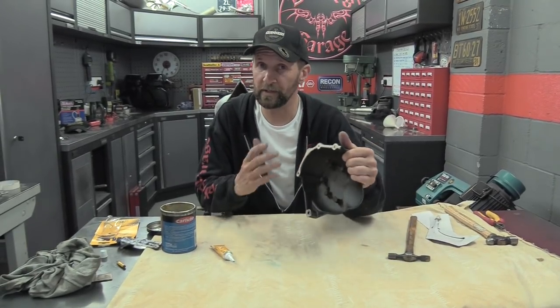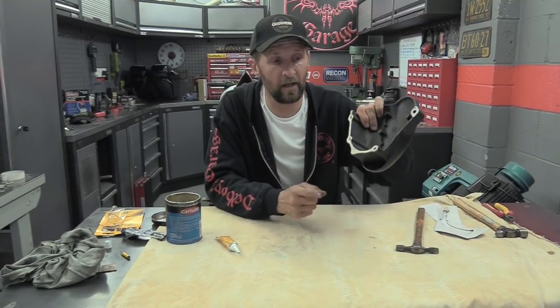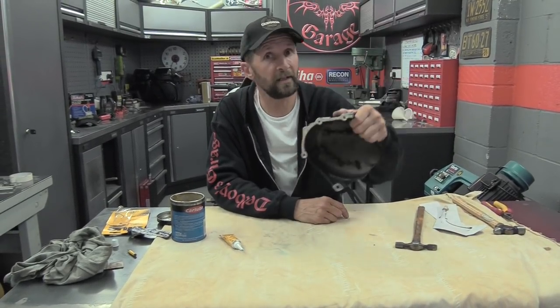If it's a less high pressure casing, if it's something like a primary or something like that, or a rocker cover gasket, it's absolutely fine. You can stick the gasket to the casing. The easy thing, you can put it on the bench and scrape off, and you can just use grease on top of it so that when it goes down on the engine, it's absolutely fine.